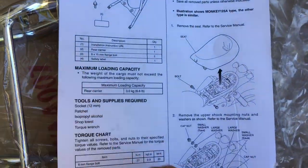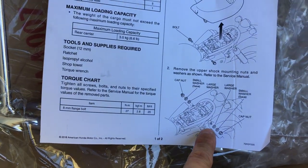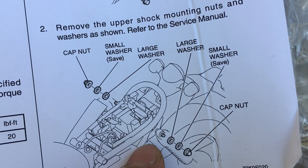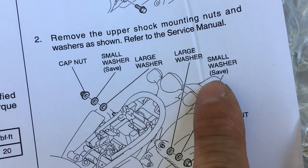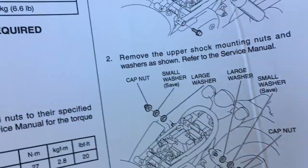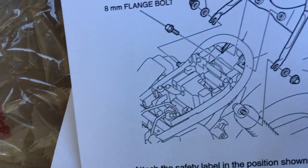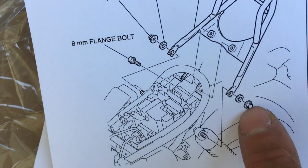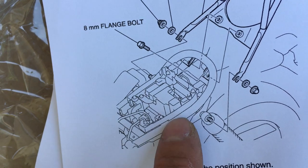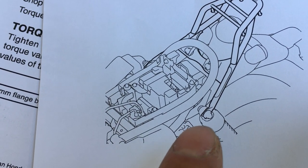Let's look at the instructions here. What they show: you take off the nut, then there's two washers before the shock. There's a large washer and a small washer, so you actually remove the small washer and leave the large washer there. In place of the small washer is the rack. So the rack goes on, then the large washer, then the nut. The rack goes on after the shock - so it's the shock, then the rack. You can see the rack is actually between the nut and the shock.